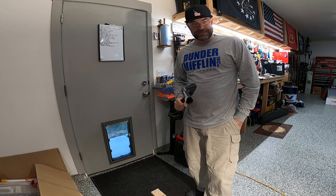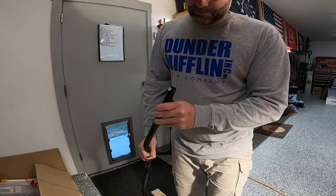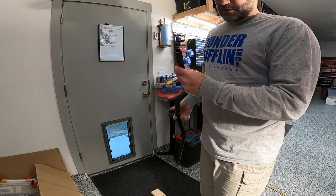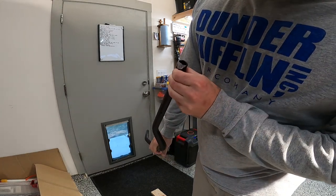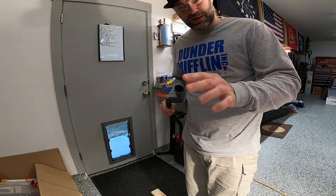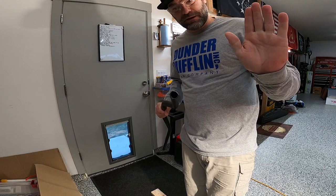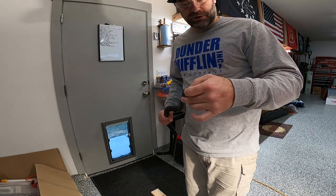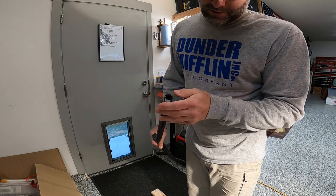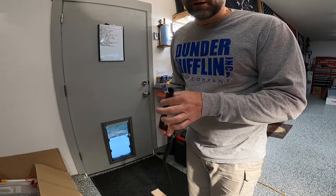If it looks like I just woke up, it's because I did — don't be too judgy, I had one cup of coffee. The throttle side didn't really get it too bad, so I'm going to try to enlarge this back to round and then paint it. The clutch side took a little bit more, but I'm going to try to enlarge it too. Really all I'm going to do before I sand, mask, and paint is get my end caps and just make sure they can go in freely. Aluminum is really difficult to work with — even if you heat it up it's still going to crack probably — so I want to be very gentle and forgiving and not just hack and whack it too much.